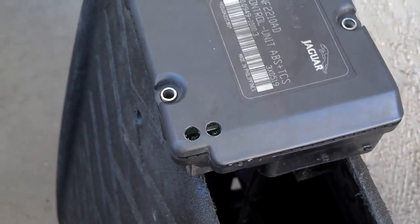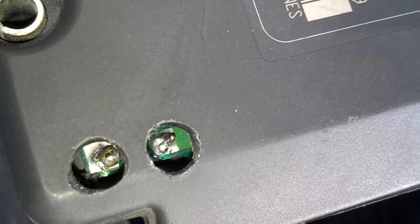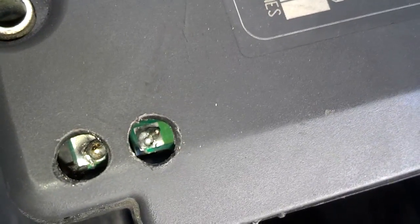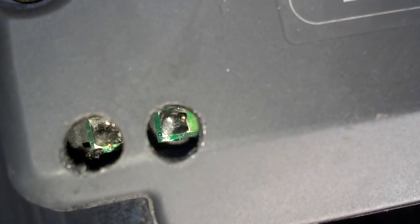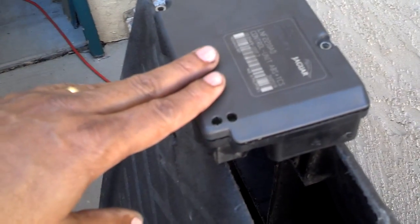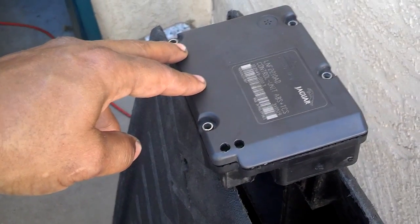I got the solder on both joints. You're doing that almost blind, so you've got to be careful — don't hold it on there too long, and make sure you get enough solder on there to get those joints flowed in good. Don't put too much and don't hold it there too long — you don't want to burn your board. I went ahead and heated them up again, 10 seconds each, and now they look better and a lot smoother. Now I'm going to clean this casing up with acetone, plug these holes with a little dab of silicone on each one, and go ahead and reinstall this ABS unit.